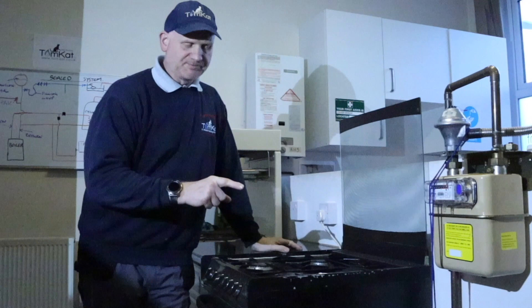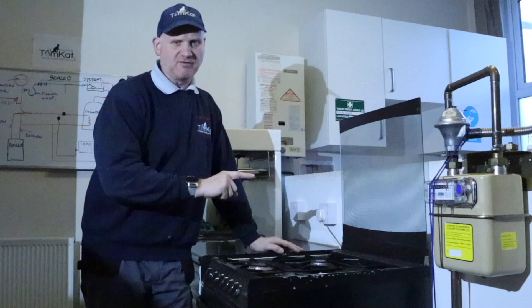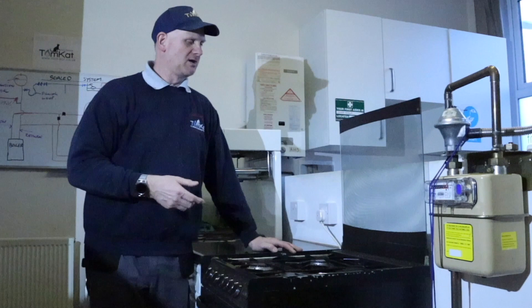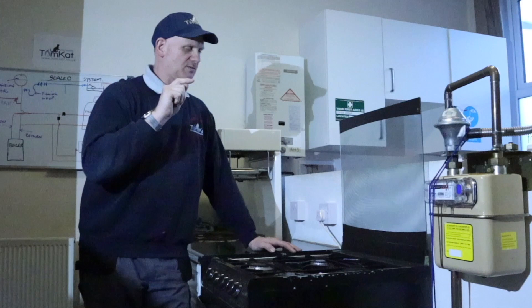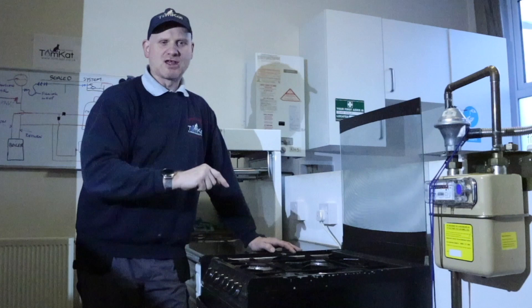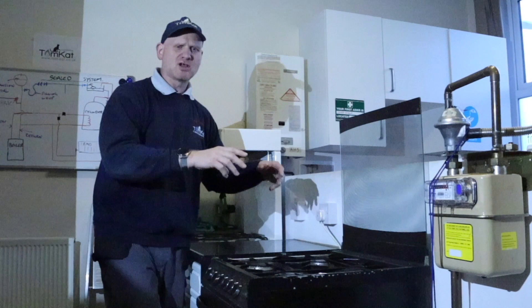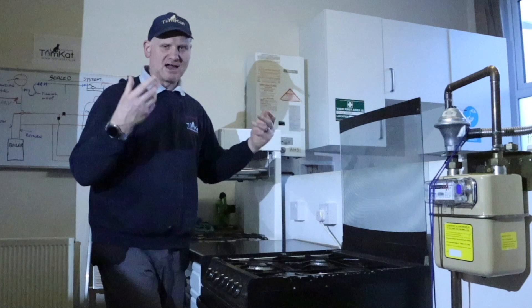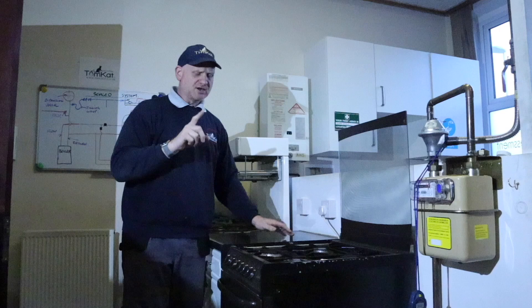If the glass is missing or broken when you go to service a gas cooker, and the safety device has not been made inoperative — so basically they're not using a G-clamp to keep the gas valve open or they've not jammed a piece of wood in there — then the appliance needs to be notified to have the lid replaced. But if the customer is using something to keep the safety device open, that would be classed as ID in the unsafe situations procedure IGEM/G11.